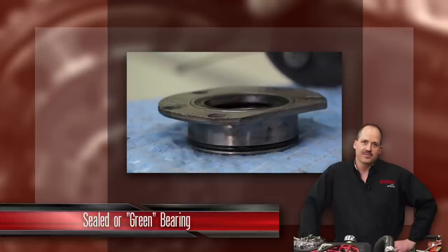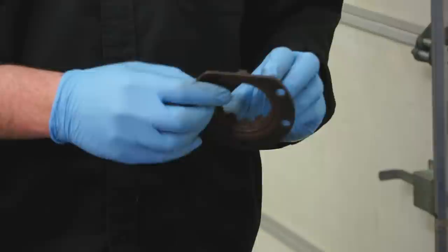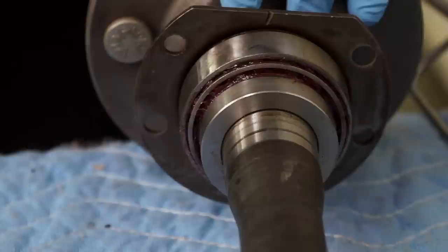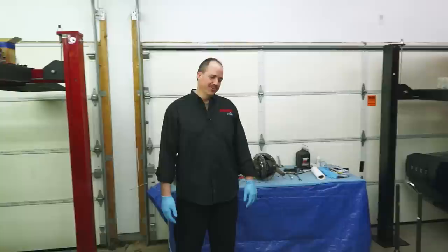Originally this car came from the factory with tapered bearings. There is a second bearing available, which is a sealed bearing usually referred to as a green bearing. This bearing comes with the retainer already assembled with the bearing. The original bearing requires a different retainer. One side is adjustable and the other side is not. The bearing retainer sits between the axle flange and the bearing. These bearings do require to be pressed on, so you will have to take them to a machine shop. They slide the bearing on first and then press the collar on — this collar is a pressed fit and retains the bearing in place. We are using the original tapered bearing for our axle assembly.